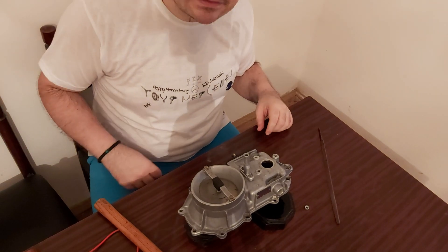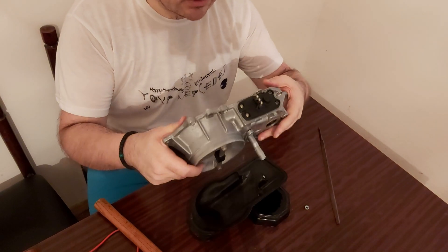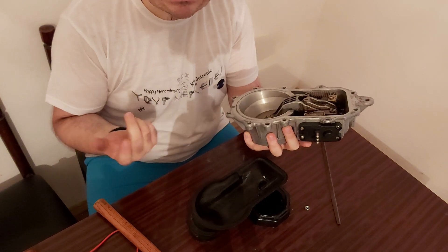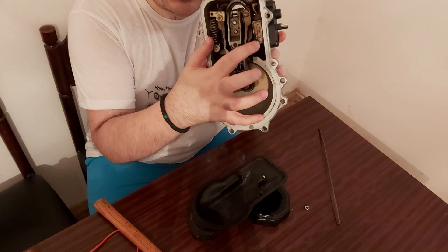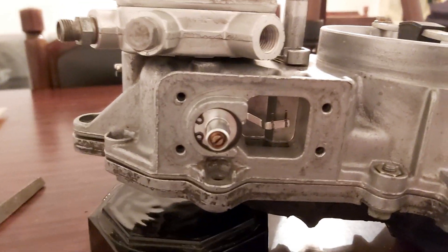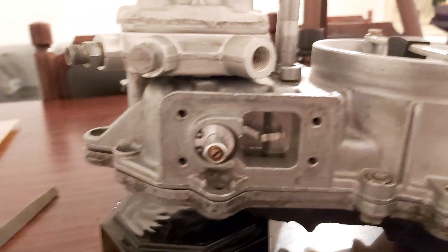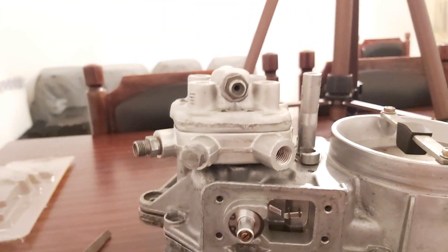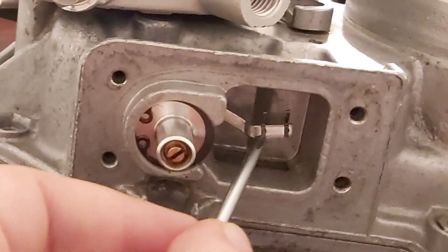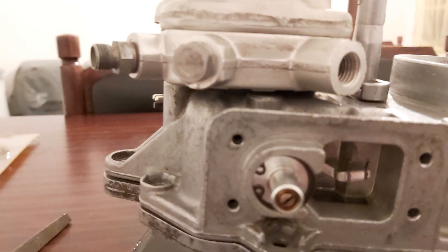As you have seen, it's not as easy as that. Just be careful — it's not recommendable to hammer this part. After hitting with a hammer, I had to take out the potentiometer to check if I didn't break these contacts — these two. Luckily they survived. Because if you damage those, if you break them, you can say goodbye to the whole unit.